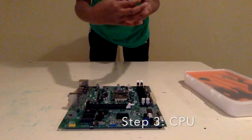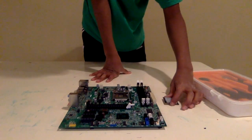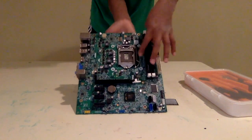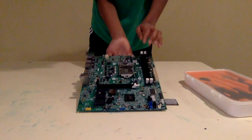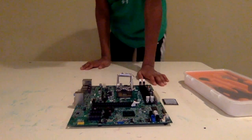Find the corner that has a yellow triangle, or gold — who cares. And then push the CPU socket clip down — might be hard for you — and then up. Push it back, and then the CPU socket should be exposed. Let me just sit around the table to show it.